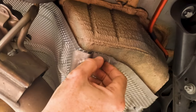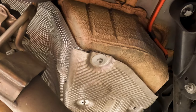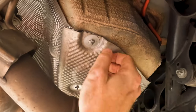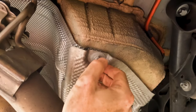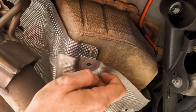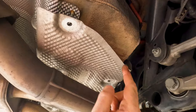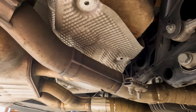In this M3 — this F80 M3 — this is an ideal place to put it. You'll notice these little hat nuts; they look like hats. These are 10 millimeter, and there are six of them — three on each side. Go ahead and take those off with a 10-millimeter socket or wrench. Once you take them off, this heat shield piece will start to sag, but you don't even need to take it all the way down — just slide the box into the space and route the cables out through the hole.